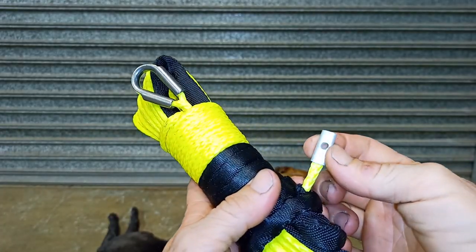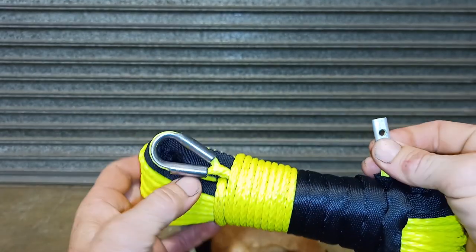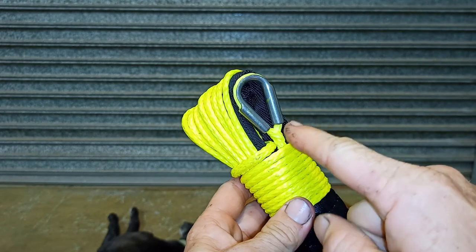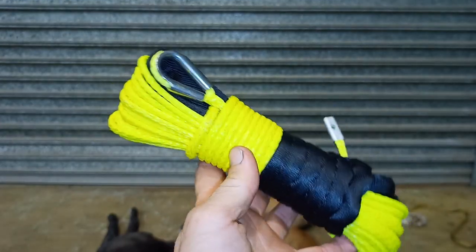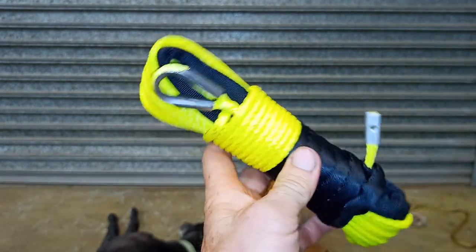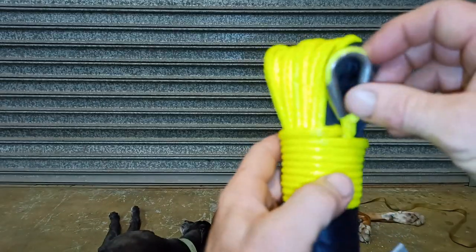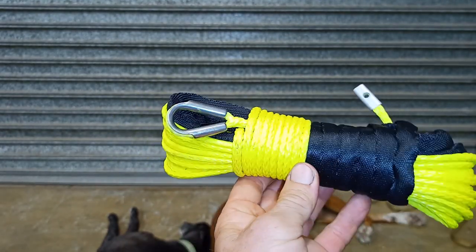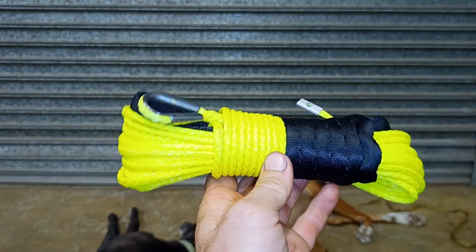You'll find — like me at some point while doing recoveries — you'll pull your winch rope out, get to the end, and the rope just pulls out from inside that little splice. That's rather annoying. I'll show you in the next video what to do about that, but for this video I'm going to show you what you should do with your rope and why you should not have that metal fitting on there. One of the probably most important things about Dyneema rope as opposed to steel wire rope is that this stuff is safe — much, much safer than steel wire rope. If wire rope snaps and recoils it will tear you to shreds.